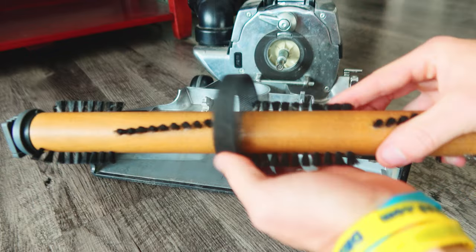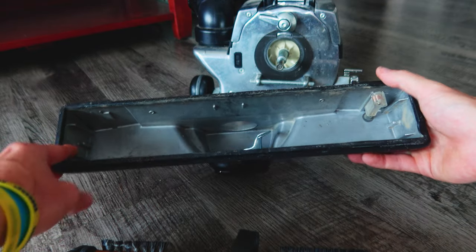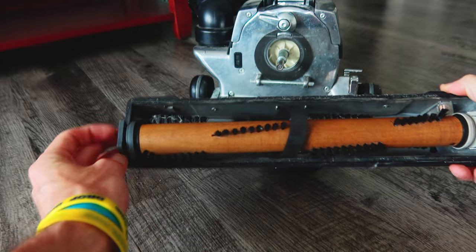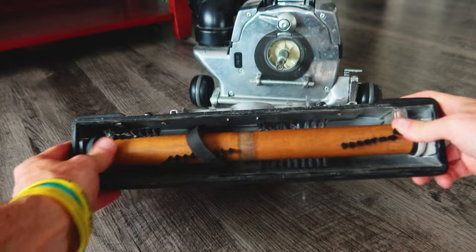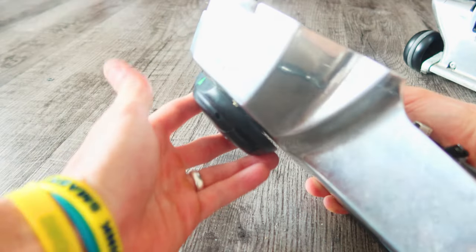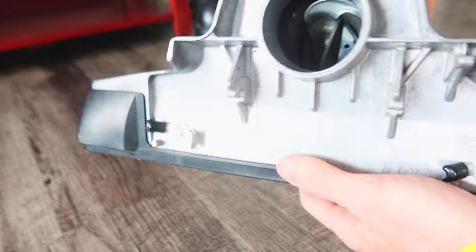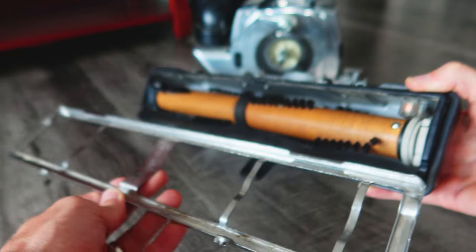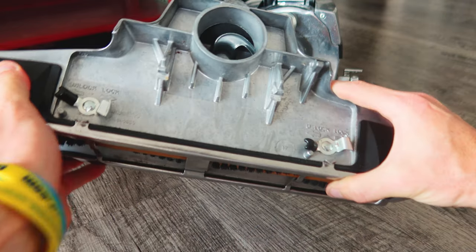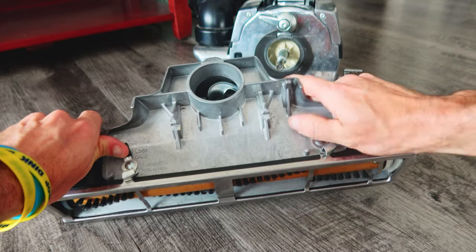You're going to slip the belt onto the middle of the roller and rotate the side rollers back to the position they were in. Note that the two side rollers have different channel sizes — it only goes in one way. Set both sides to the one position, then press the brush roller into place. Hold the belt in position — you can see through the hole there's a hook. Grab the belt-on/belt-off tool and rotate it counterclockwise; the hook is going to grab the belt, put on some tension, and lift it up into the on position. Then grab the bottom grill plate, slide the two little hooks onto the front side of the power head, and roll it on.